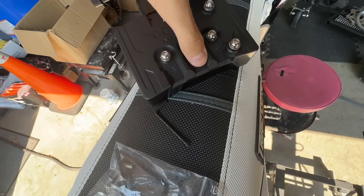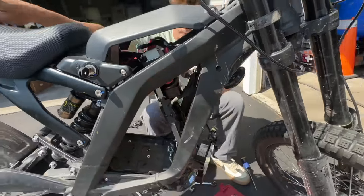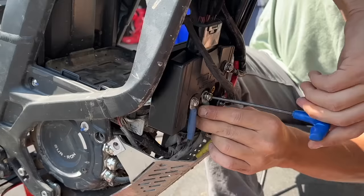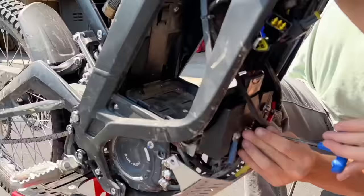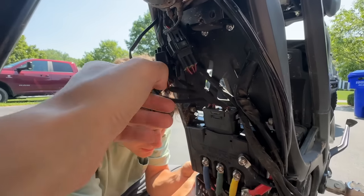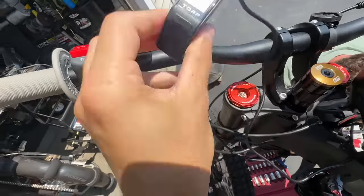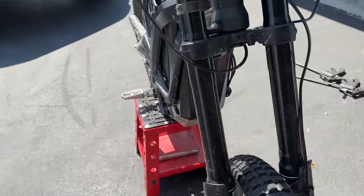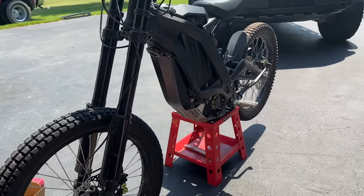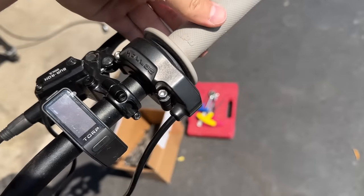Pop the back to give you wiggle room to unplug everything, unscrew all the controller bolts, and it'll line up. Blue, green, yellow — pretty straightforward, you really can't mess it up. The hardest part will just be getting all the wiring back tucked in to close this up, but it's not too hard. Go through the backside — it's way easier than what mine was to install. Same plugs, so just match up the plugs and they plug in. Bolted up the plate back, mounted, put the cover on, and we'll get the display mounted up on the bars. All done — looks super clean, almost better than stock.